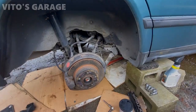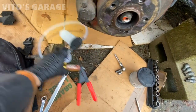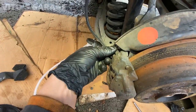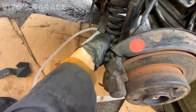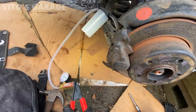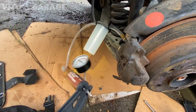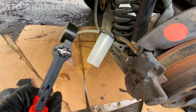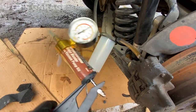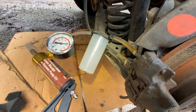You want to start with the right rear wheel. I've got my vacuum pump ready — the bleeder is loose. I'm going to attach this and we're going to be sucking the fluid out into this. It's flowing slowly, but it's going. It might take a little bit compared to if you had another person helping you, but that's okay.